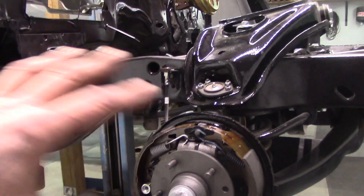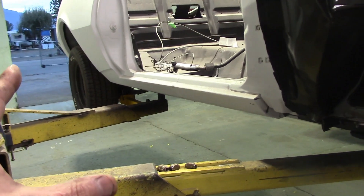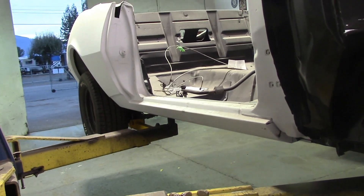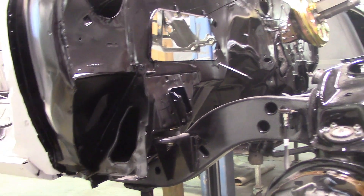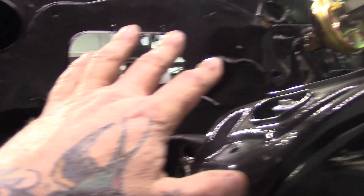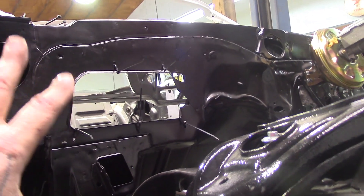Tomorrow I'll get the drums on, get all the brake lines run to the front, and figure out what goes up to the booster. I can't do the back yet because I had to order backing plates — the diff doesn't have backing plates on it. I do have the gas line kind of hanging here, looped in the air — got that all run. When the customer comes in maybe next week, which is payday, I'll get him to bring the heater stuff and wipers, get the heater core renewed and mounted in there.